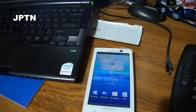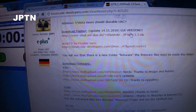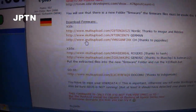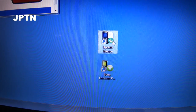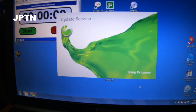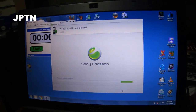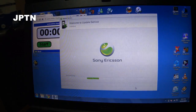To start off, go to the website in the description and download the flash tool. Next, download whatever 2.1 firmware you want — X10i or X10a. Once you've downloaded those, you have to have Update Service and PC Companion installed. You have to start by going into Update Service and using the official method to make sure everything works properly — your computer is set up, the drivers are installed, and you can get your phone into flash mode. If you can't update using this official method, then you have to check your computer — something's wrong.